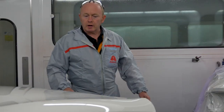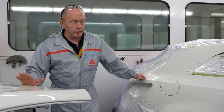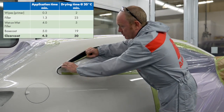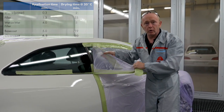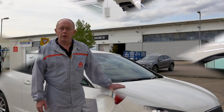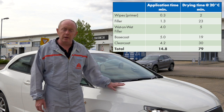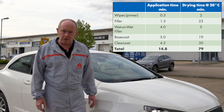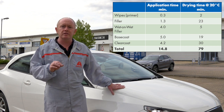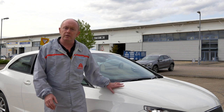It's been 30 minutes since I finished applying the clear coat and all I've done is leave the booth running at 20 degrees C. As you can see it's really dry and the finish is superb. All I need to do now is de-mask it and take it out of the booth. This has been dried for only 30 minutes and as no ramp up time to 60 degrees C was needed, the actual drying time is comparable to or even shorter than existing systems. I've left the car for another 15 minutes and now it's ready for reassembly and if needed it can be polished. The end result is perfect and equal to if not better than existing or competitive systems whilst consuming minimal energy. This is a full system from wipes to clear coat — only by using the full package can you really gain the full advantage. The technical data sheets are key — please read them as they contain all of the information you need.